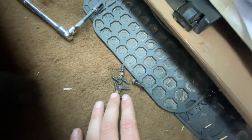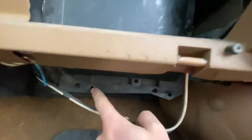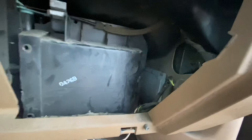You're going to have seven eight-millimeter bolts that you need to take out, located one, two, three, four, five right up there, and six, seven. You will need to unhook this line which sits in here — you just push this up and pry it out — as well as unclip this one right up here and the one on the side. Then you'll be able to freely pull this out.